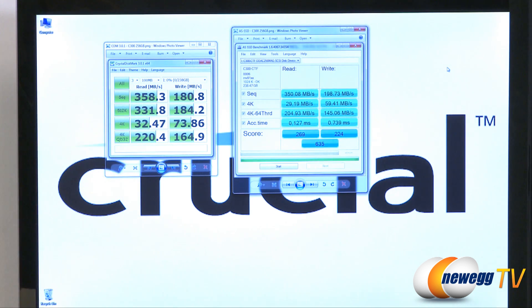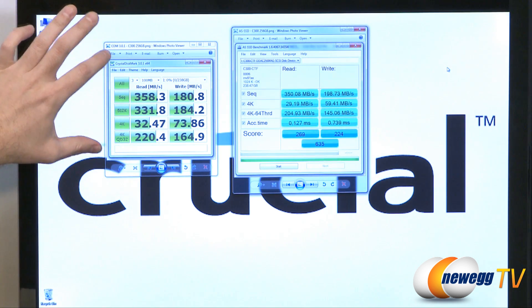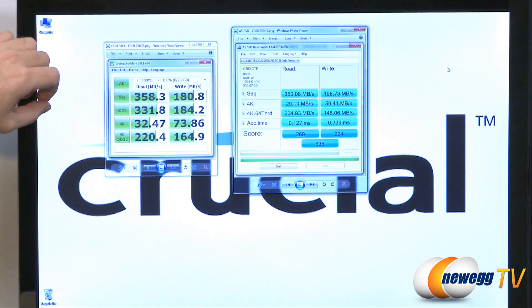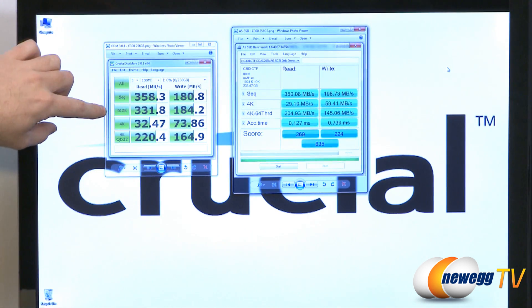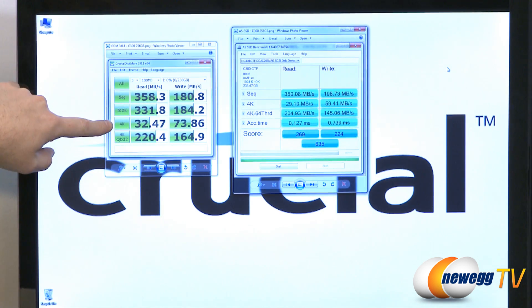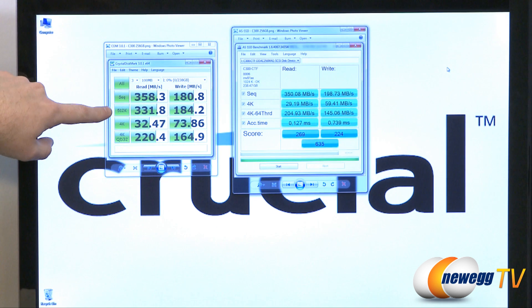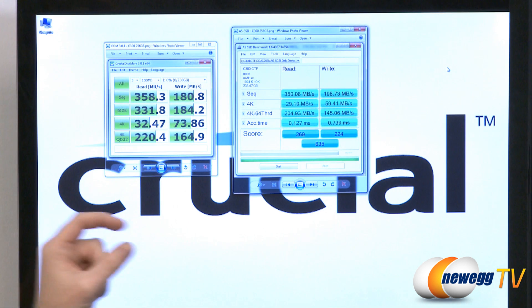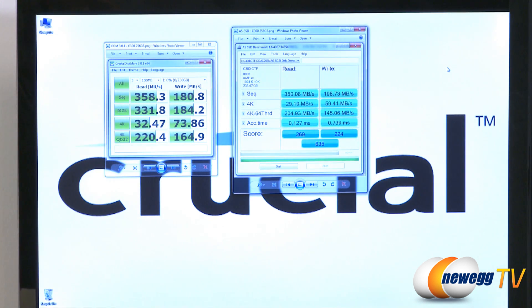This is right about on par with a couple SSDs we reviewed about a year ago. On the CrystalDiskMark test: sequential reads is when your operating system tells the drive to access a bunch of data written all in a row, so it can access it very quickly as one big block. Write is the same thing. For 512K and 4K, this tells you the speed at which it can read and write 512K blocks and 4K blocks — 512K is significantly bigger than 4K, so the numbers get closer to our sequential reads and writes. For 4K, we're reading in very small blocks, but this is really indicative of a lot of the work your operating system does on a normal basis, so the numbers drop a lot.